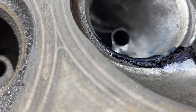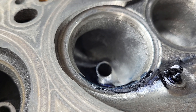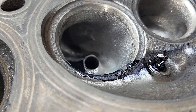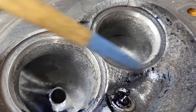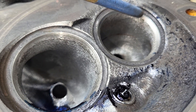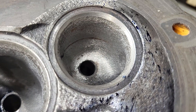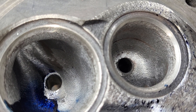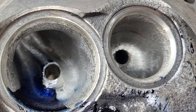Let me comment on the chamber — this did get hit with the burr. Notice it still has a bit of a lip around here; I'm not going to go nuts on it because I'm still figuring it out. It got a little work here and here, and that's it — this is pretty much the way it came from the factory. It's got a big notch here; if you work on that you probably gain a little exhaust flow. In reality it shouldn't be machined out like that — it should be more of a ramp into the valve seat. All right guys, 15 minutes looking at some old junk we're going to use for testing — I appreciate you hanging out.